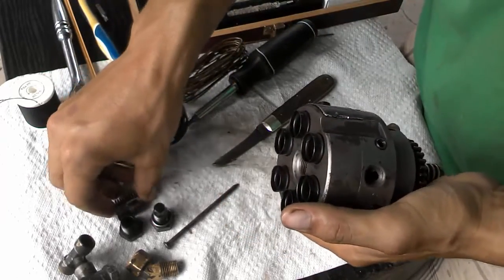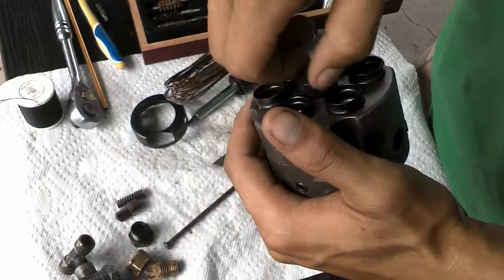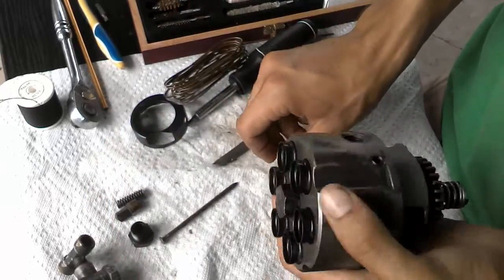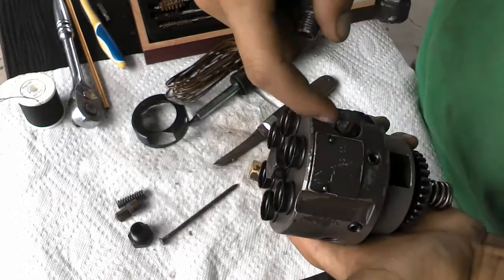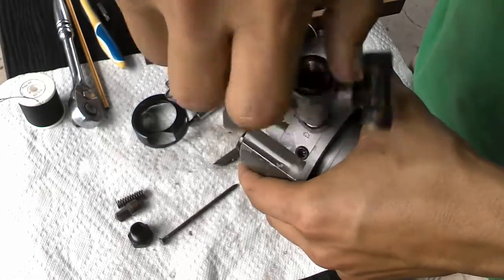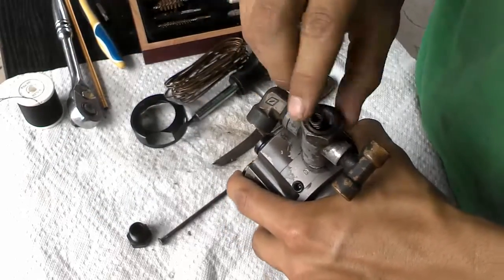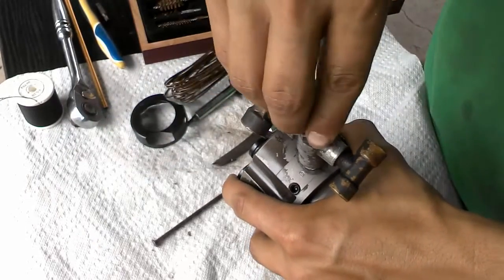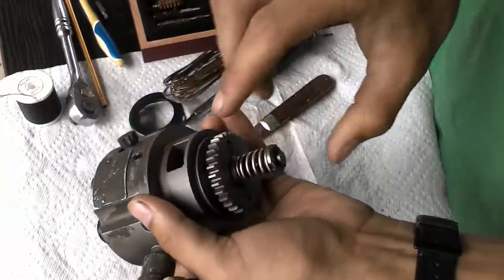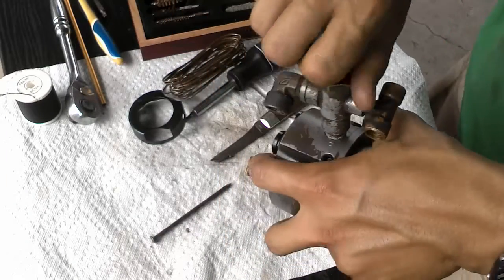Of course all of these are going to need tightening with a wrench — hand tightening is not going to be sufficient. There's a lot of pressure that builds up in here and hand tightening won't do it. Make sure you have your T-port on the left side of your 12-sided bolt, because if you put that thing on your engine with it on the wrong side, you're going to hate yourself when you have to pull it back off and switch them around. Lube everything — especially this shaft here — with a little bit of diesel fuel, not gasoline. That will go in a lot smoother and twist a lot better.